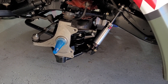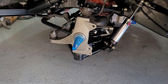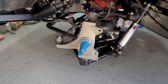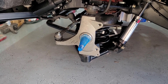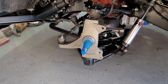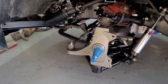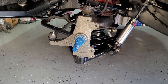I went ahead and took the old CPP spindle off and the new one is on — it was a perfect fit. I ordered this spindle from AZ Pro; this one is a 71-72, and it fit the CPP control arms. There can be variances in CPP control arms — on some like the pro spindle, I think it uses 73-and-up components and those ball joints may be different. But on this one it was a perfect fit.